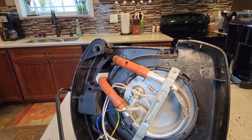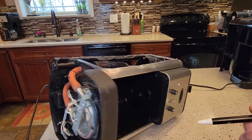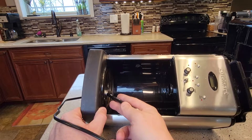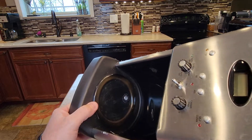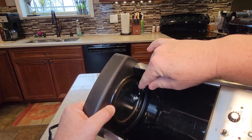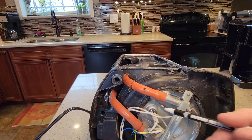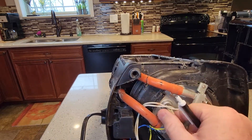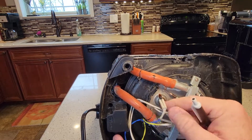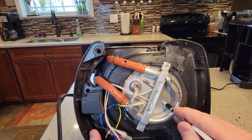So there's what it looks like — the tube, the heating element. The heating element also heats up the warming plate, which keeps your coffee pot warm. Most Cuisinarts have this component here that looks like some kind of thermostat to monitor how hot that warming plate is — you can pull it out.